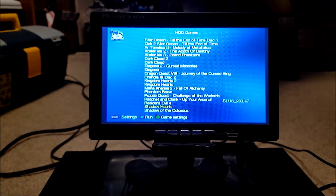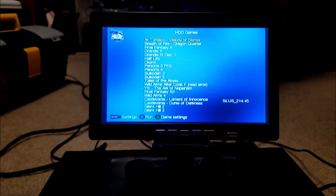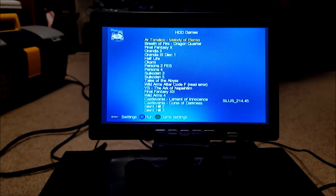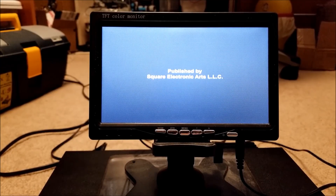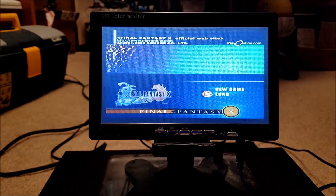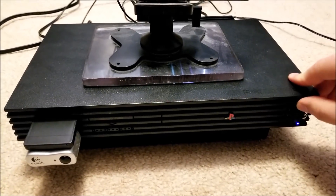This was actually a very simple mod to do. It was pretty cheap — I know you can get complete adapters that are already pre-made for about 15 to 20 bucks, so a little bit more than what I paid. But with the way I did it, I get to use the original adapter and it just looks so much better. Let's just fire up Final Fantasy X and see if that works. And there we go — we're in like Flynn. Everything works, and now I have a 320 gig drive in there that consumes much less power than the old one. In terms of access speed, I don't notice a difference, so I'm not having to wait longer for games to load or anything like that. All in all, I'm pretty happy with this.